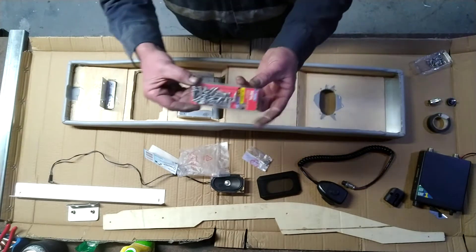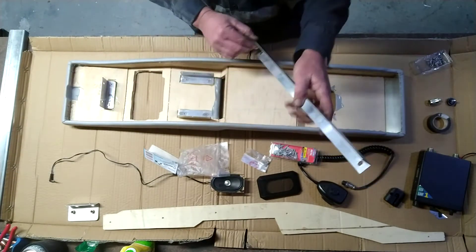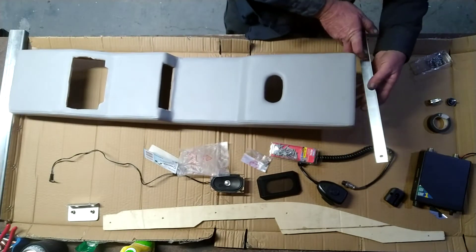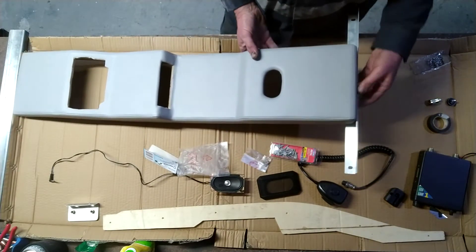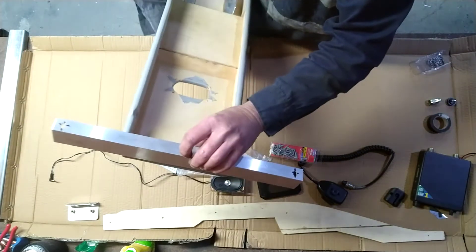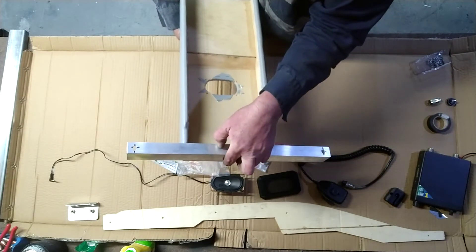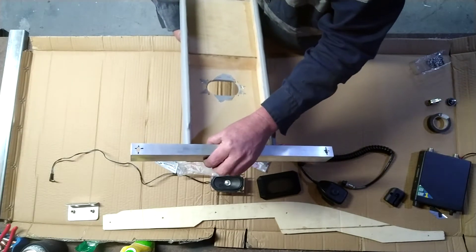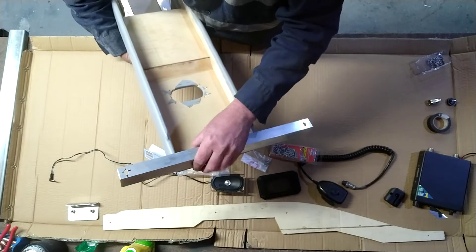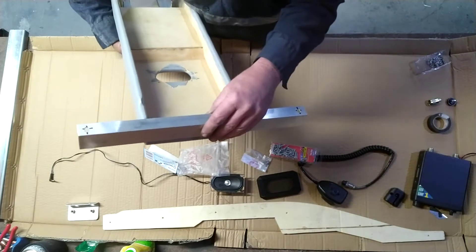None of these metal self-tappers — that's where this plate comes in. I haven't painted it yet, I'll just need to do the final bits and pieces. Being at the front, this is the rear, this will actually sit like that. I made a bit of an inlay at the top underneath here, so I need to work out where the center is, drill through. I've got the cargo barrier so I'll put two holes in, work out where they're going to go, countersink these so it's a bit flatter, then give it a paint.